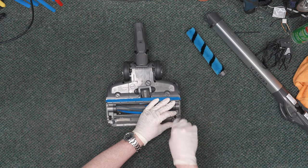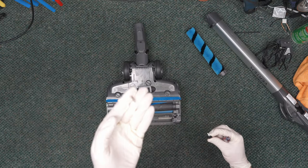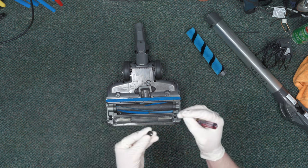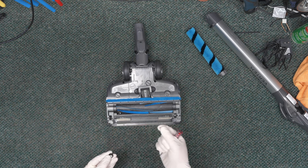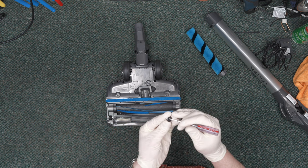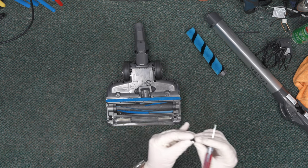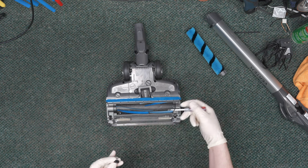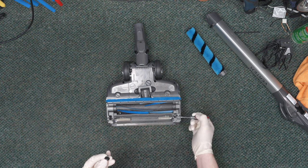The next thing is to clean your front wheels. Take a small screwdriver and pry up on these wheels. You can already see fuzz after very minimal usage, and there's a fiber washer on one side, but hair accumulates on that side too. Keep these clean — this is a velvet-covered wheel meant to be non-scratch. If you get dirt bound up in here, it won't turn; it'll stay flat, creating a flat spot. Eventually it makes the machine harder to push and maneuver, and you risk wearing the wheels down so far that the base starts contacting your floor, which is what you do not want.